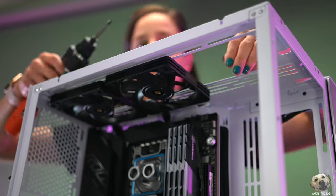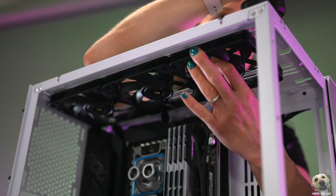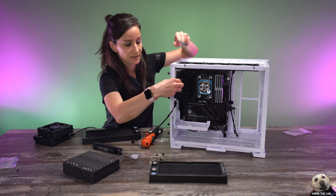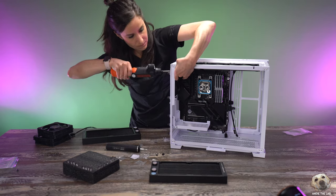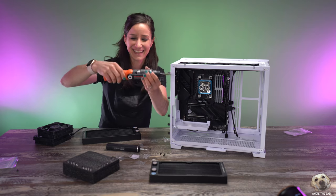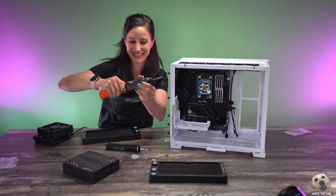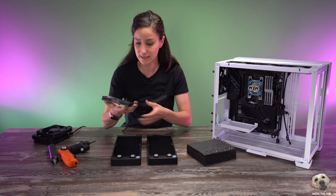When you're mounting fans directly onto a case, use the screws that come with the fan. I suggest not tightening the screws all the way until you have your fans in place so you can line it up exactly how you want. We'll also attach our back fan — which again is going to be exhaust — so it goes this way, except we don't want the cable in the front, so we turn it so the cable is in the back.